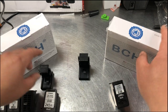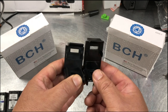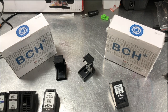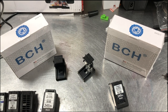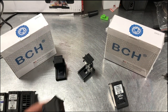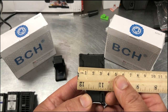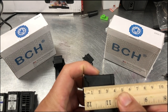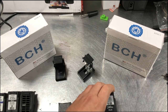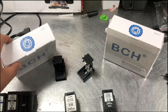The difference between those two kits is only the clip — everything else is the same; the short kit just has a shorter clip. For international buyers with different model numbers — for example, 245 becomes 845 — just take a ruler and measure the front of the cartridge. The short one is about 3.5 centimeters; the tall one is exactly 4 centimeters. No matter what number it is, if the height matches, this kit is going to work.